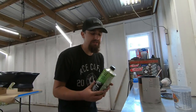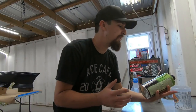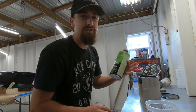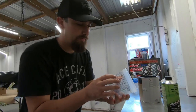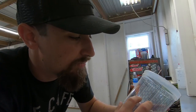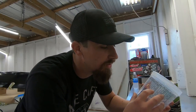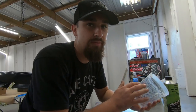So since this bumper is so flexible, what we wanna do to really help that and try to make sure the paint's not gonna come off is I'm gonna use this universal urethane flex additive. So what I do is I mix this in with my base coat as well as my clear coat. So my base coat uses a 2-to-1 mix ratio. That's 2 parts base coat, 1 part reducer, and then I'm gonna do a 1/2 part of the flex additive. So I'm gonna come over here, 2-to-1, I'll go to number 5, and then I'll also go to number 5 for 1 part, and then for over here, instead of going to number 5, since I only wanna do a 1/2 part, not a full part, I'll go to number 4.5. So that's 2 parts, 5, 1 part, 5, 1/2 part, 4.5. That's how I'm gonna do my mix ratio, 2 parts, 1 part, 1/2 part.